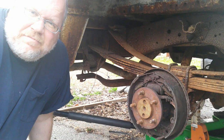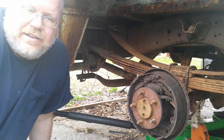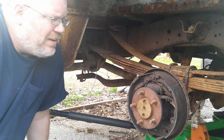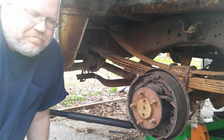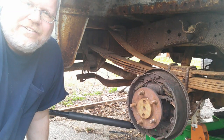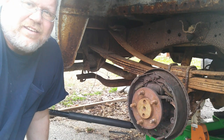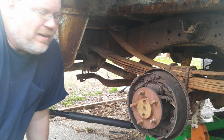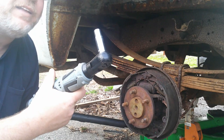It's been a minute since I've done anything on this truck on camera. I had an issue where the throw-out bearing came off the fork — turned out to be a whole lot easier fix than I was anticipating. Back to getting this thing on the road — need to change the wheel cylinders in the back. I ordered two wheel cylinders and unfortunately one got lost. I'm going to go ahead and do the one I got, and look at the hard lines and soft lines to see what we need to put this back on the road.